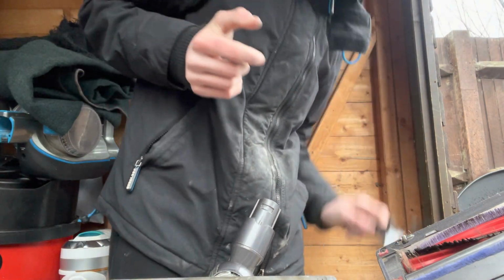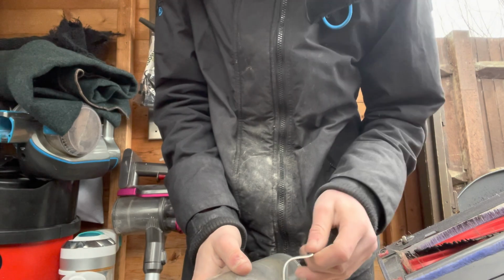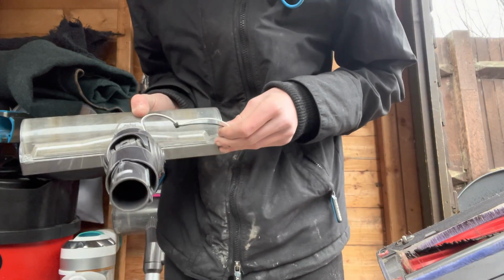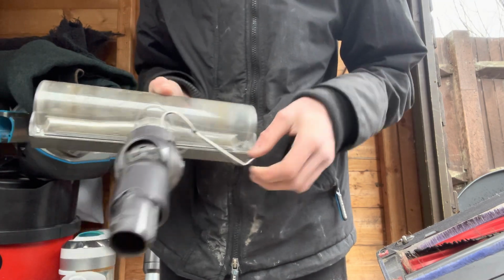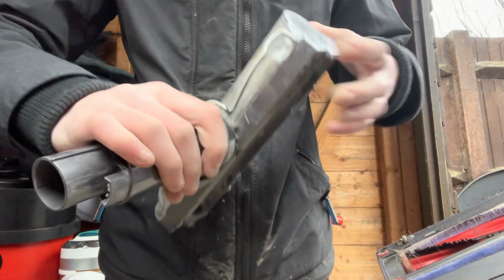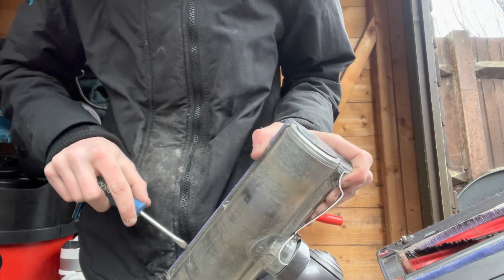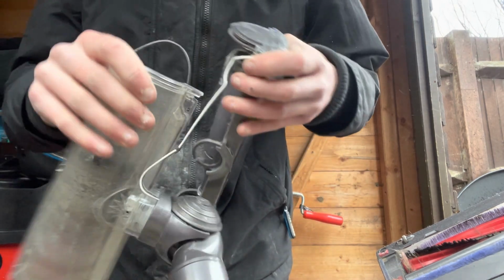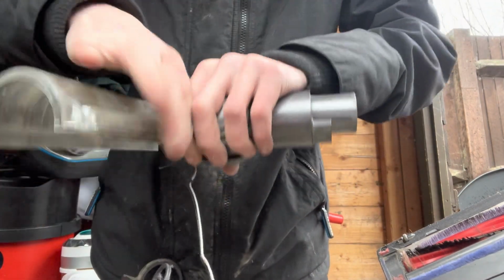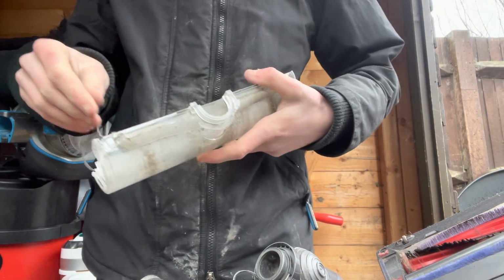You got that. Put that into your cleaning bucket or sink or wherever you're going to clean your stuff in. And then pull these wires, don't yank on them, pull them to the corner so they're out a bit like that. Sometimes this can be a bit stiff, so get your little flathead or big flathead and just pry up against the front of it and then lift. You will have that come with it. If you just get the head and start twisting it, just so you can do a click like that with a bit of brute force.